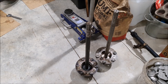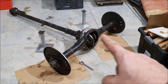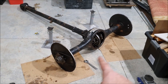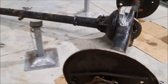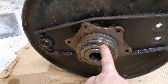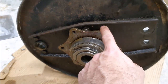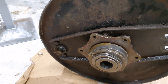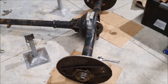I managed to get both half shafts out in the end — they're pretty tight in there and it takes quite a bit of work. Theoretically now I should just be able to pull the torque tube with the differential out of the axle housing and dismantle the rear backing plates and bearings. There's a nut on here, threaded with a spring clip to stop it coming undone — this is the main rear bearing. There are star-shaped plates; I've bought new ones with modern oil seals to stop oil getting on the brakes.